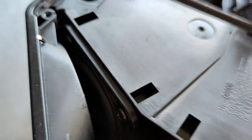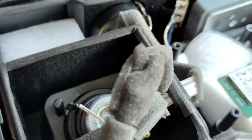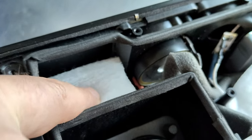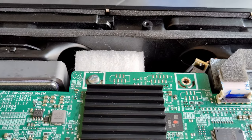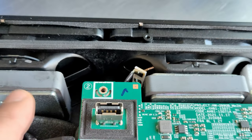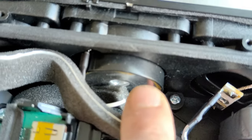inverted dome, with the same special cabinet for them. It's not a mixed cabinet. And the Dolby Atmos speaker here has a special cabinet as well, because when we close the soundbar we cover this, so it's a different enclosure, let's say. Here we have a special treatment with this white foam to reduce the vibrations and isolate the compartments inside the soundbar. In front we have one tweeter here, two racetrack drivers with this kind of magnets, you see, on one side. In the center we have the same racetrack drivers, one, two, and one tweeter in the center, in